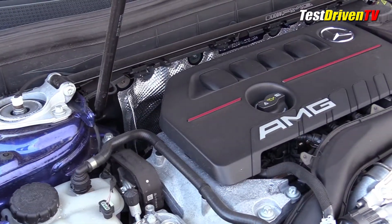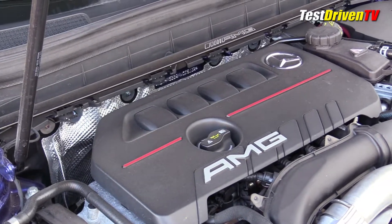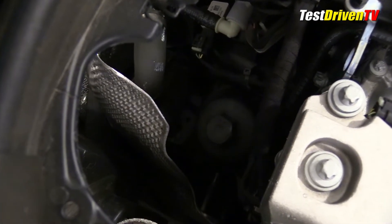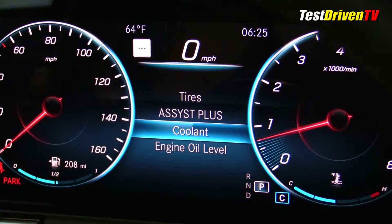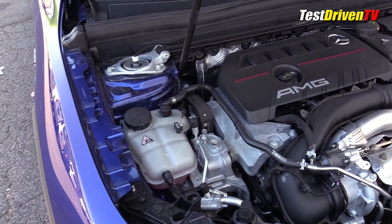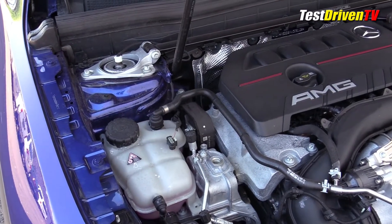The oil filler cap is found at the top of the engine with no need to remove the sound cover to fill. The oil filter is located on the rear passenger side of the engine and accessible to change from the top, not below. To check the oil, you must power up the car in accessory mode and read the level via the computer system service menu on the instrument cluster. Lastly, the coolant reservoir can be inspected and filled on the passenger side of the engine compartment, just adjacent to the strut tower.